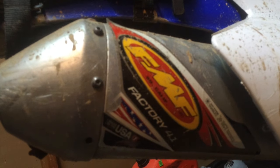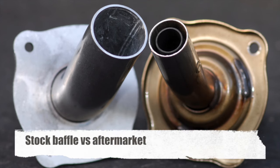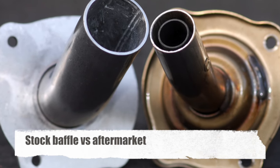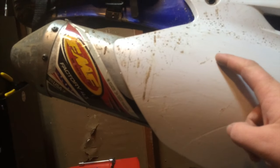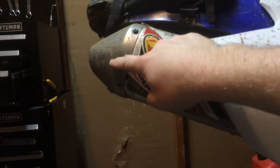These kind of exhausts don't ever have to be repacked. And the last one on the stock pipe is this little tiny pea shooter. What you can do is either completely remove it, but the air won't exit very clean. So you can get an exhaust tip that fills up the diameter of that hole — it's a nice straight shot and the air will be able to exit cleanly. It'll make a lot more power and a bit more racket. These pipes have a series of baffles — there's actually three: one up at the front, one toward the middle, then you have your spark arrestor and your end tip.